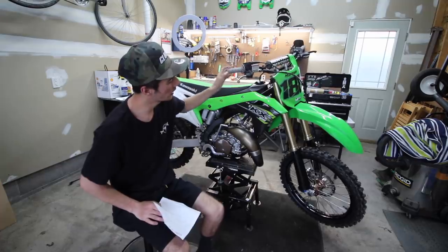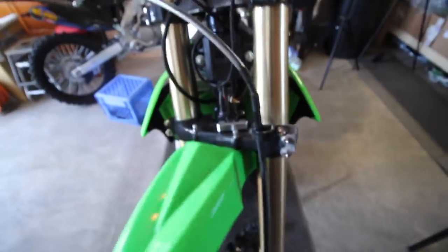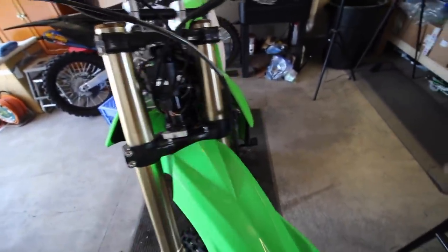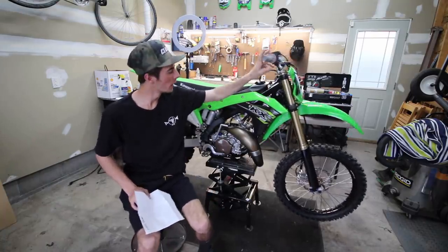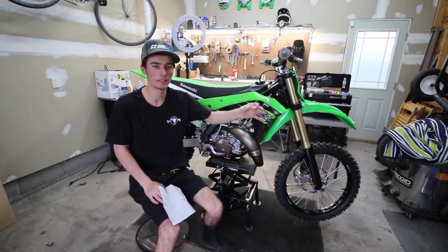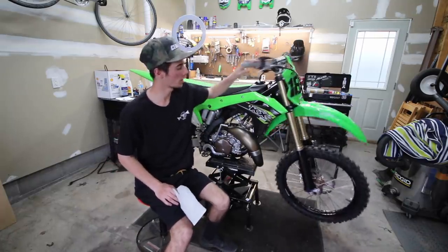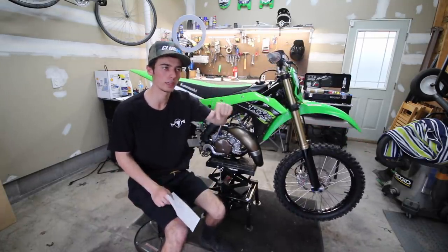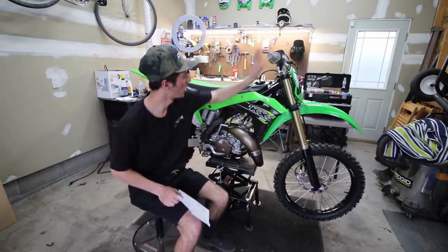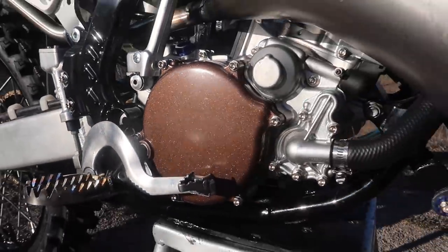From Trick Engineering I got the steering stop, because if you upgrade from the stock 2003 or whatever-year forks to 2010 or newer forks and triple clamps, the triple clamps will actually smash into the frame — you'll need a custom stop since it won't hit the existing one. Trick Engineering hooked it up with a stop for that, so it's all dialed in. Also got the Raptor titanium foot pegs — super sharp, keep your boots on the peg so they don't come off.